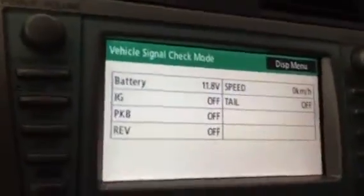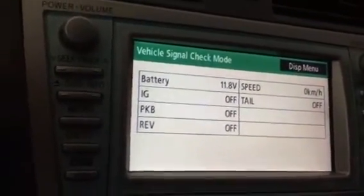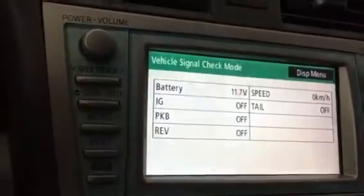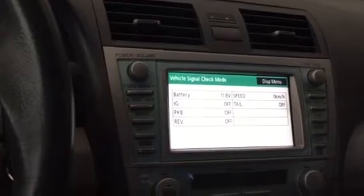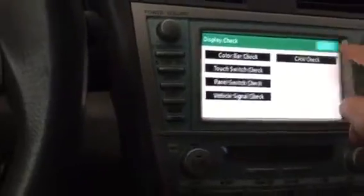And there's your battery right there — see how it's at 11.8 volts. Because I started the car it's actually a little bit higher. When you turn on your lights it should go down — see how it goes down. That's how you check it. My main battery had two bad cells, so I thought the whole big battery had gone bad, but it wasn't — it was just the regular 12-volt battery.